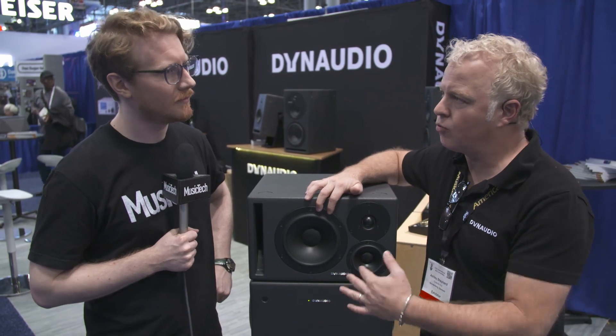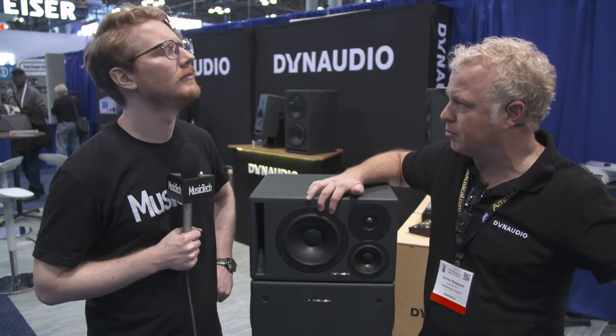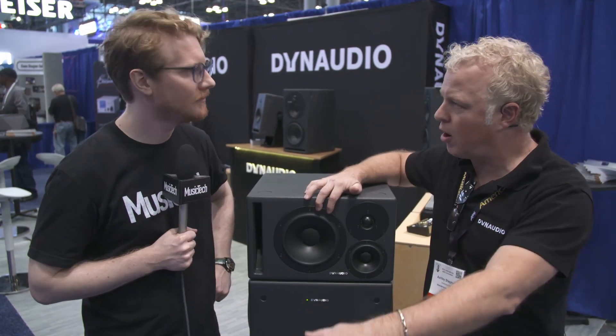How low does this go? The 3dB roll-off is at 44Hz and 6dB down at 37Hz. I think that's very conservative — it doesn't feel that way. The roll-off is very usable because it's very linear; it's not like it just drops off into oblivion. You get a nice smooth, continued response, just rolled off a little bit.